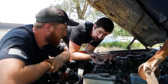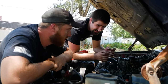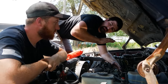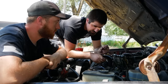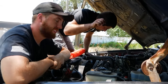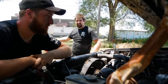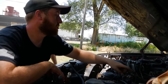And then IDIs, as mentioned before in the video, they are a flat top piston. Some of them, specifically the factory turbo diesels, have very small reliefs in the tops of the pistons, but for all intents and purposes, they're a flat top piston with a flat cylinder head deck with a cup drilled into it, and a small port, probably no longer than yay wide by yay narrow. The really small port just shoots that flame front into the cylinders, and that's how you get your power strokes. Suck, squeeze, bang, boom. With extra squeeze. Extra squeeze. And then extra push squeeze, too.